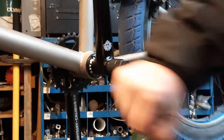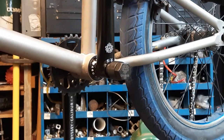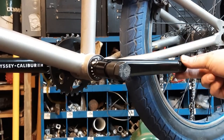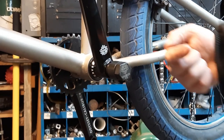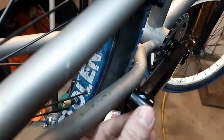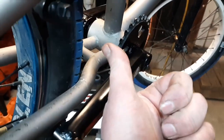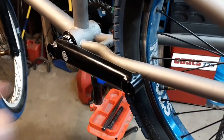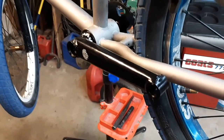Take the crank, push it over this way, push it back, and make sure the crank does not hit your frame. Do the same thing to the other side — drive the crank back and make sure that arm does not hit that side of the frame either. You want to make sure it doesn't hit the chainstay when the crank is pressed all the way. Also check that the gap is the same on the right side as it is on the left side. The reason you want to do this now, before the crank is driven all the way on, is that if you have to remove the crank arm it's significantly easier to take off now than when it's fully pressed on the shaft.